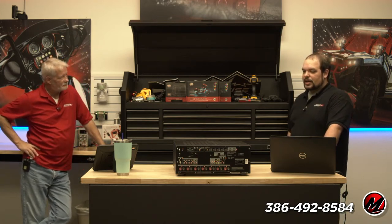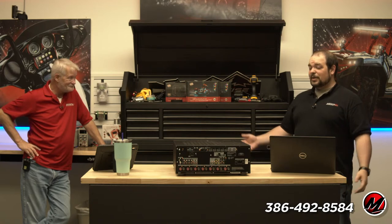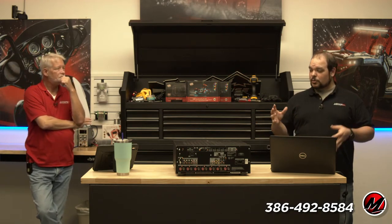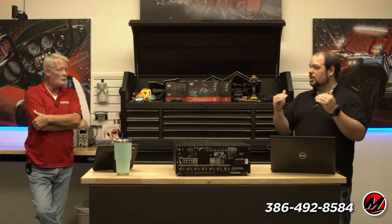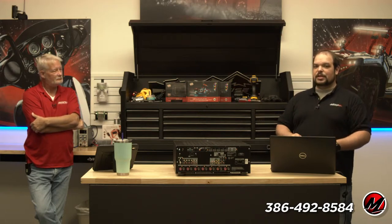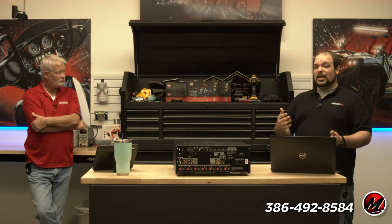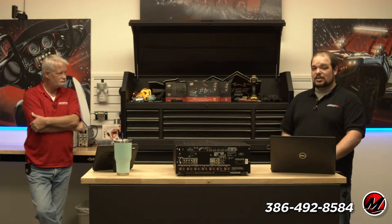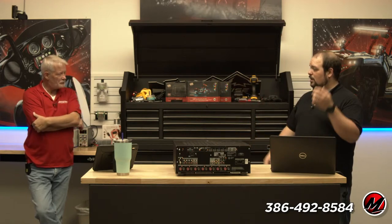Now TVs are smart and have all streaming services built in, but put a Roku or Apple TV in there instead because ARC and eARC — and eARC is better because it's more capable and has tighter governance — are still imperfect. Don't use the smart apps in the TV; it's simpler and easier to use an external device. If you want one remote control, CEC usually passes straight through. Amazon has a great remote for their device — volume control and everything else is intuitive — but it actually works on IR rather than CEC.